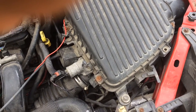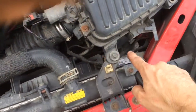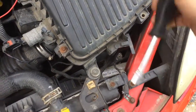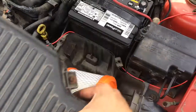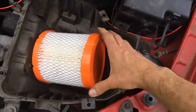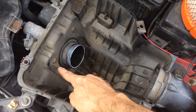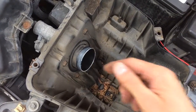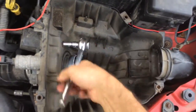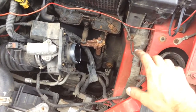To remove the air filter canister you're going to need an eight millimeter bit to get these screws off along the edges of it. Take the cover off there. You have to remove your air filter, and then we're going to want to take off the air filter canister and detach it from the throttle body right here.